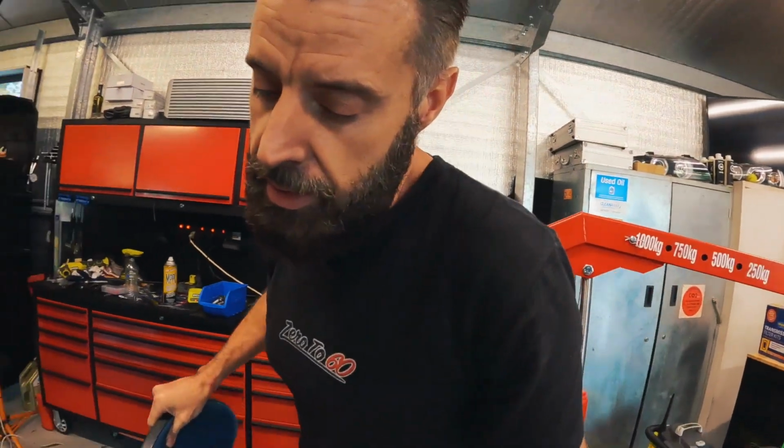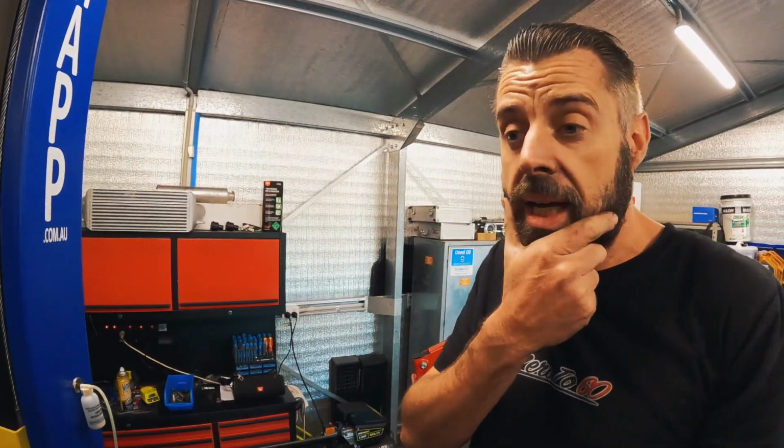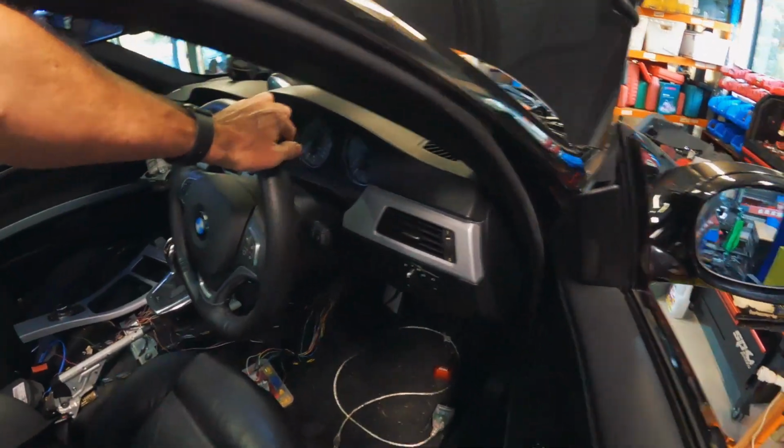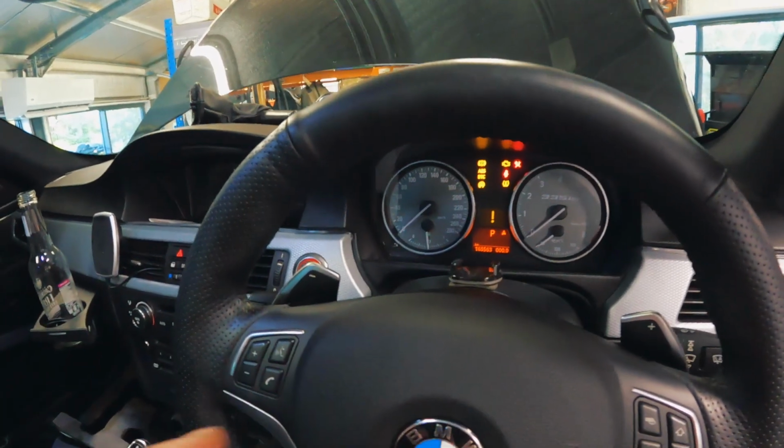Guys, I'm nervous. Basically I need to see if the car will start, and then get temperature in the gearbox to set the DCT fluid, pretty much like you do with the ZF6s. I can't put it off. I've just got to start it, see if it works, see what errors we get. I spent most of this morning trying to get WinKFP to work, and that software just hates me. I cannot flash the combi with the right software to display as a DCT on the dash cluster. I was trying to do this last night, but my dash cluster still looks like an auto.